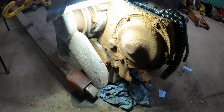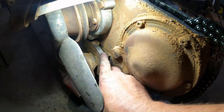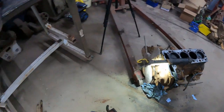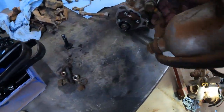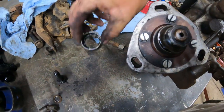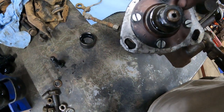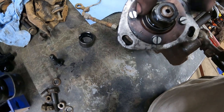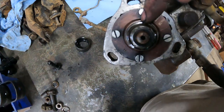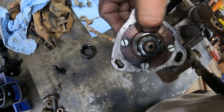Again, the next important point is to install the injector pump. You want to have this set at 45 before top dead center, and then you will go to your pump. Hope I can do it with one hand here. Once you remove the collar that drives the pump, you have a mark out here. Some of the newer pumps were missing some teeth. That's their mark. You want to verify that this and the shaft are aligned.